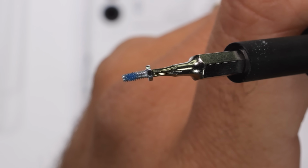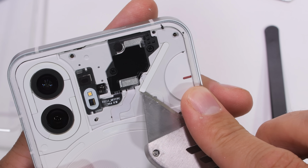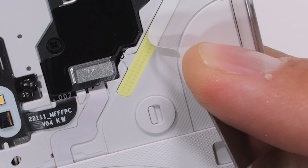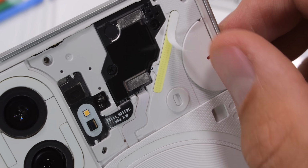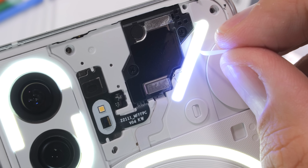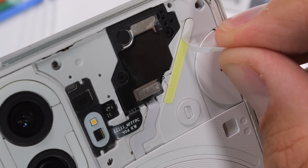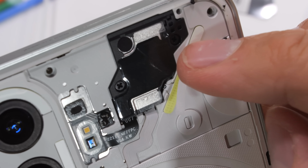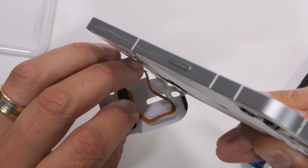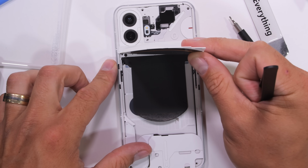If you remember, I did count the individual LEDs of the original Nothing Phone 1, and we got 971 total lights all lined up in pairs. And it looks like this time around Nothing is doing the same thing again, pairing up LEDs under an aesthetic white diffusing sticker. The LEDs themselves are a brilliant blue shade, up in the 6000 or 7000 Kelvin, and the sticker brings it back down to a more 5000 white daylight color temperature, taking special care, of course, to distinguish between color Kelvin and temperature Kelvin. I haven't measured, of course, but I'm going to guess that the LED strips are not 10,000 degrees Fahrenheit.